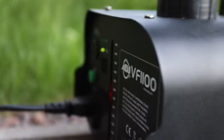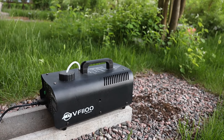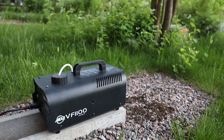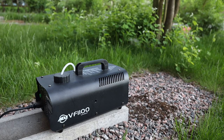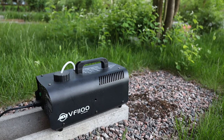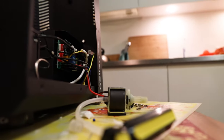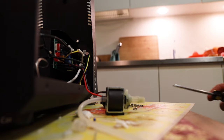It's heating. Still nothing. The heating element is okay because fluid is going through. But now there was a problem with the pump — it was dry, so it wasn't putting any water through the pipe.